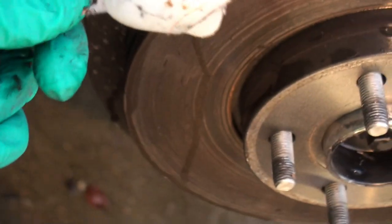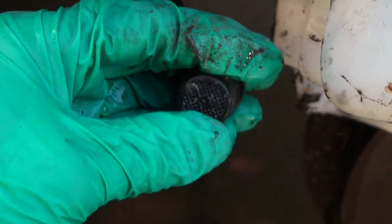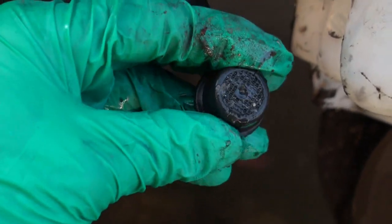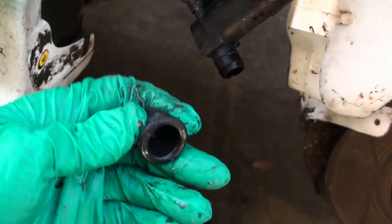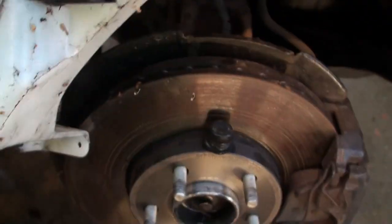So what I'm going to do is take this whole tank off, actually, disconnect everything, go and wash it out, because I think there is a load of crud in there, and this could be the problem. Although, when I pressed the wiper request button on the end of my stalk, I could hear a click, but I couldn't hear any whirring, so maybe it is the pump, but this isn't going to be helping at all. So we'll compare those bits. I'll take those, and to remove this connector, let's just put that on there.